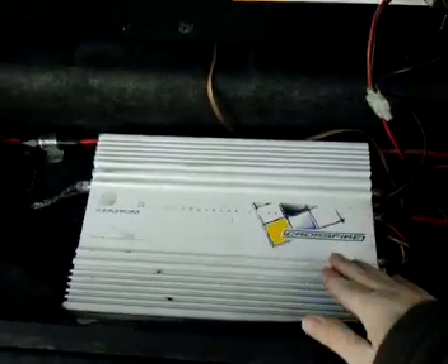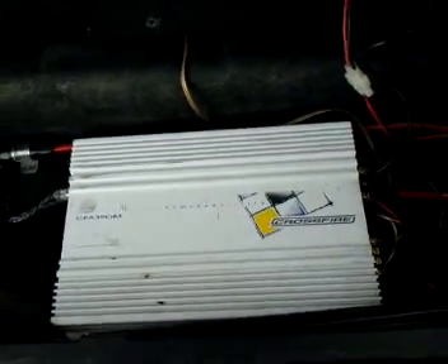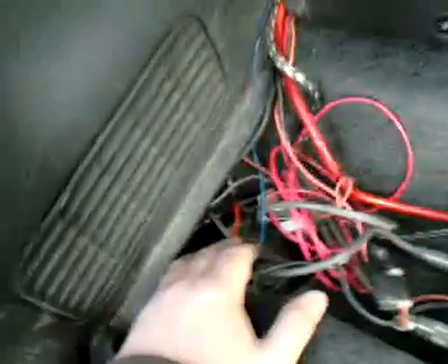I also put in a smaller, just a little 200 watt per channel amplifier in here which is bridged. It's got 4 gauge power wire and I had to add another fuse to extend it a little bit. It's got a 10 meter amplifier in here for when I use 10 meter. And then hidden back in here is a 2 light strobe power supply.